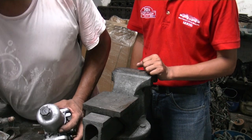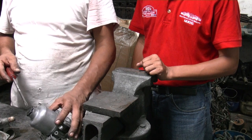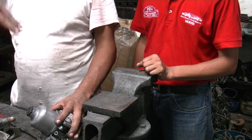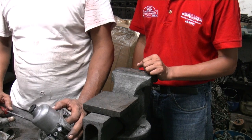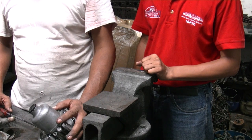Just a question here, Sam. When it's too rich or too lean, how are you telling? Are you listening to the exhaust note? You get different RPM, so you're listening to the engine speed and engine smoothness. You're aiming for it to get as smooth as possible, the best, smoothest idling speed. And possibly go back to the exhaust pipe and give it some smell, the petrol smell. So you get high on minis.